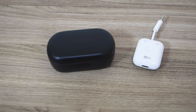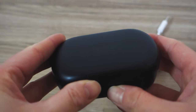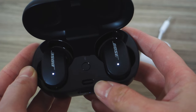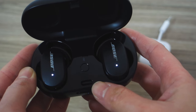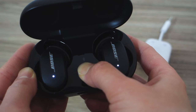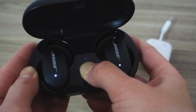To get started, place the Bose earbuds in their charging case. Open the lid and check to see if the earbuds enter Bluetooth pairing mode automatically. You'll know they're in pairing mode if the status light on both earbuds are slowly pulsing blue. If not, simply press and hold the button in the charging case for 10 seconds, or until the earbud status lights slowly pulse blue.